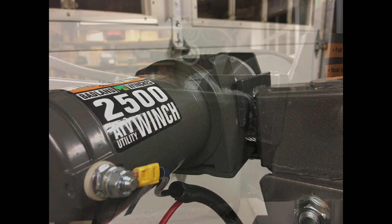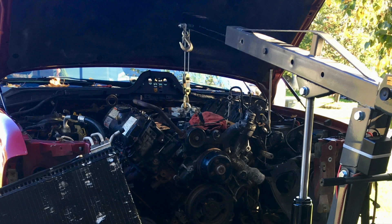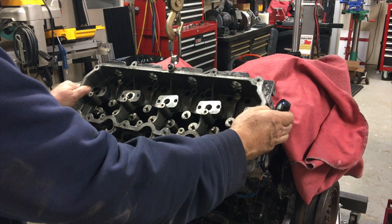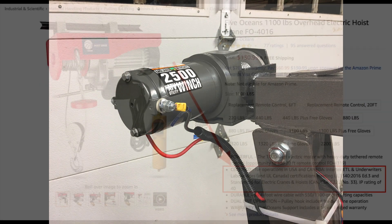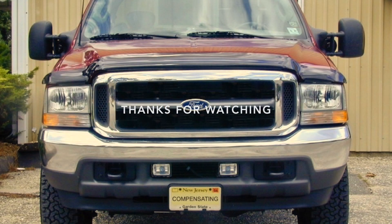As I stated in the beginning, for me this has been a useful modification. It allows much better, fine positioning control than just using the hydraulic ram, and I can do it while I'm guiding the object in place. It's the winch I had, so I used it. And with the doubling of the cable, with the 6-liter, it's only being loaded 500 pounds. Thanks for watching. And buy a hoist.